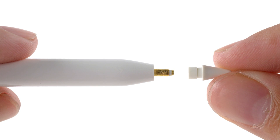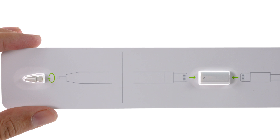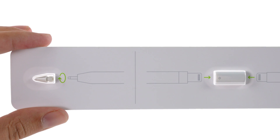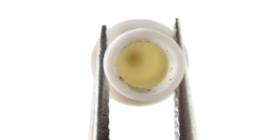The tip of the pencil came off without a fight as it just unscrewed. Apple was nice enough to make at least this part of the pencil user-replaceable, and they even went as far as to include a spare tip in the package. A peek inside the tip reveals a tiny metal bit sunk deeply into the tip, presumably to get as close to the screen as possible. This likely connects to one of the two emitters in the tip that allow the iPad Pro to determine the pencil's angle and orientation relative to the display, and adjust the pen stroke accordingly.